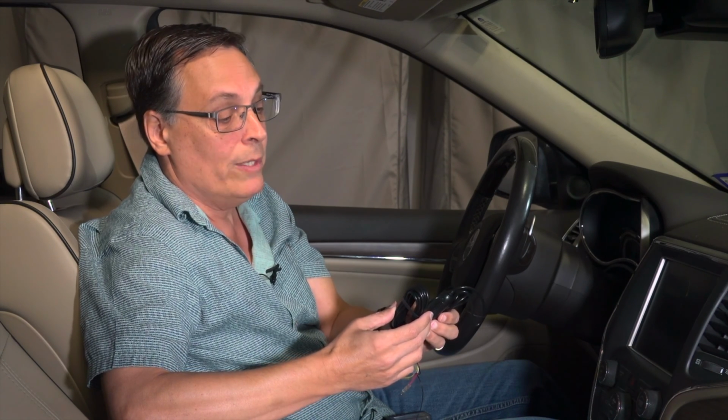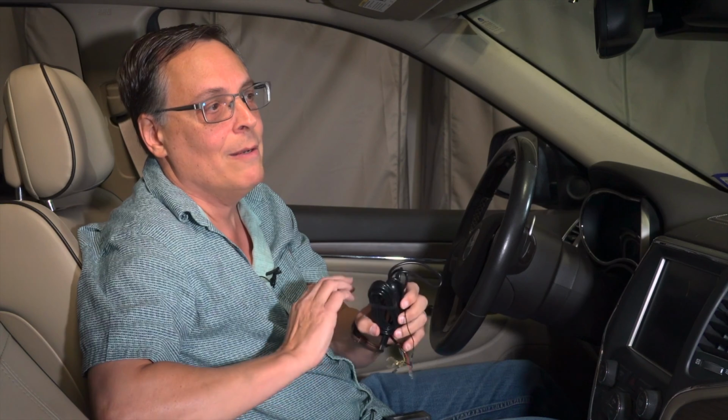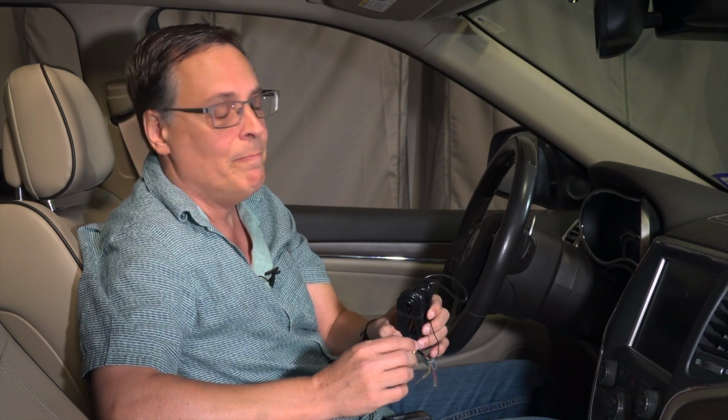Now, I contacted DDPAI about this, and what they told me was that yes, it does do a 24-hour time lapse, but supposedly you can also have it do 24 hours of regular recording. Now that's the last thing you want, right? You do not want your camera running for 24 hours straight, especially with no low voltage cutoff circuitry. I would never do that. As a matter of fact, in all of my other cars that have this feature, I never let it stay in parking mode more than maybe 2 or 3 hours. Any more than that, it's likely to have an effect on your car battery.